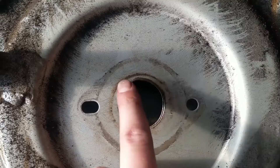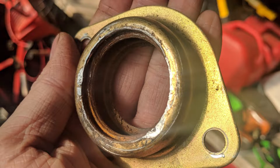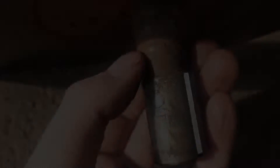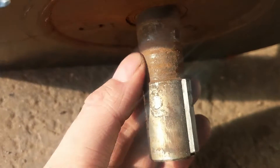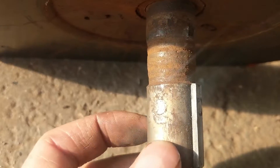The hole was starting to wear out — boring out up there, no good. Because this was left so long, the bearing ended up being completely destroyed. There is absolutely nothing left of it; the bearing housing is all that remains. The shaft itself has also started to wear down, so after all the years of driving it with a bad bearing, the shaft has been ground down.